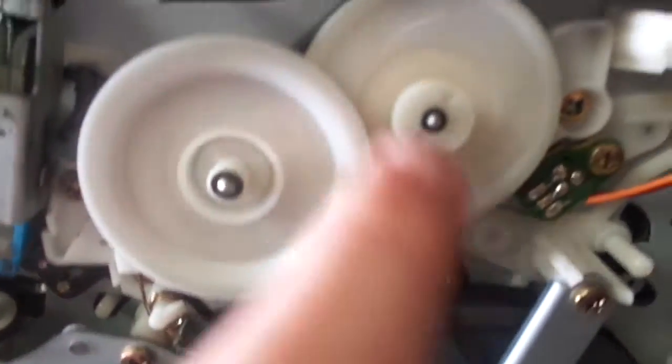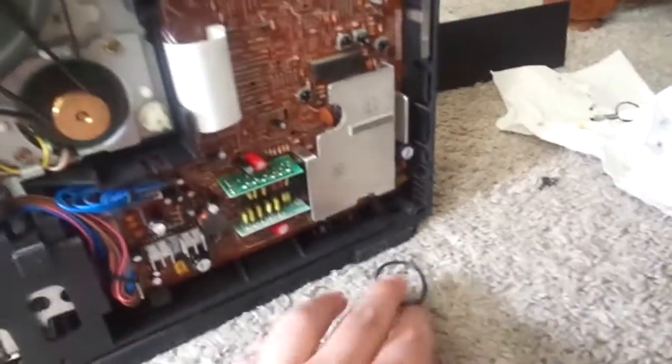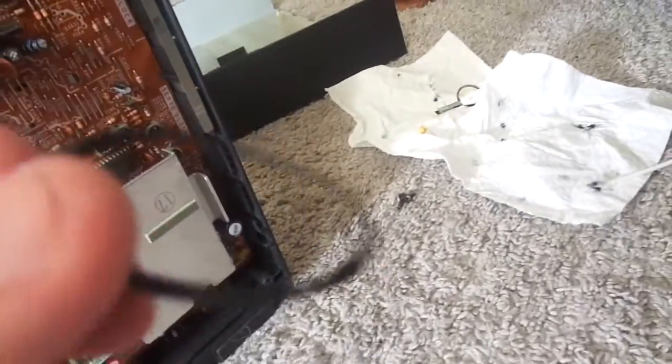Let me show you the belt system in action. Here are the real pulleys — the idler pulleys, two of them. Here's the new belt for the idler. Here's the flat belt — you can see it turning on the flywheel, looking really good. And here's the head drum motor, which is spinning. Here's some grease on the loading motor, and I had to replace this belt right here. Here's the original — doesn't look too worn out, but I could still use this in a future VCR.